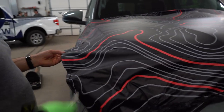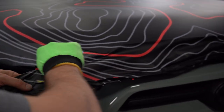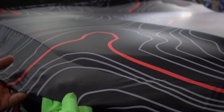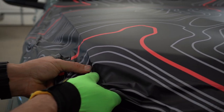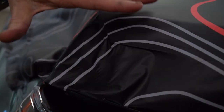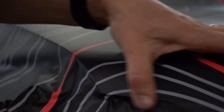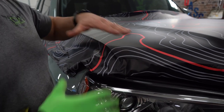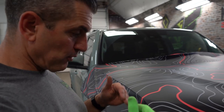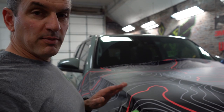So we'll start with our corners. I'm going to get rid of a little bit of the excess — there's a bunch there and you don't need it, it's in your way. We're going to take our corner, pull it up just a little bit, and all I'm going to do is pull a little bit and hook it on there. Then I'm going to run out from those edges. What we're doing is hooking that vinyl — not with heat, just pulling it, getting a little teeny bubble. Then we're going to apply heat to each of these corners. It's going to suck that right in. I didn't heat it first because if I heated it, I can overstretch it. Right now I'm not overstretching the vinyl per factory specs.